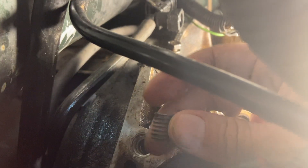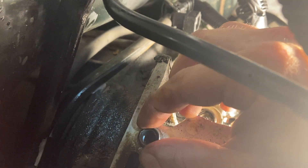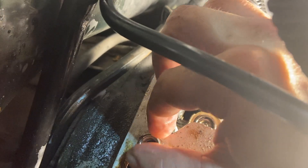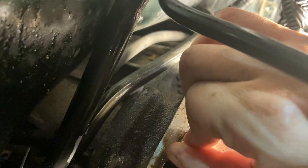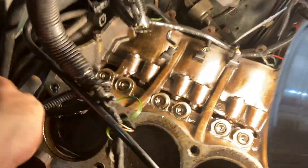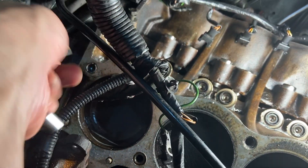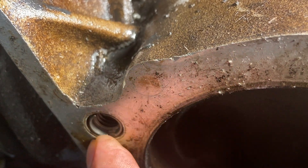I made the hole a little deeper. Now let's do it — the little holes need to be at the top. Gently put it in and make sure you feel it screwing in smoothly. These sleeves usually come with a kit tool to install them, but since I didn't buy the whole kit, I'm using a feeler gauge because it's wide enough to fit in there so I can turn it.